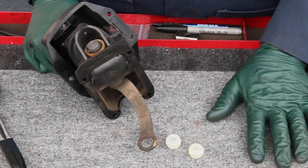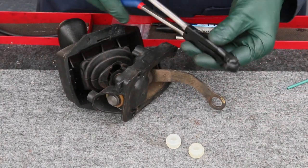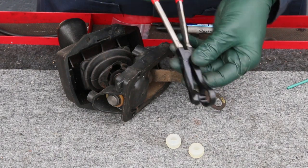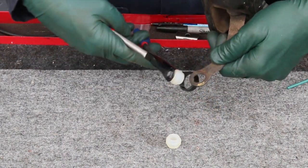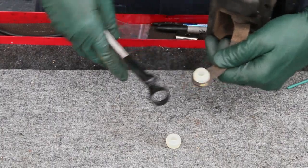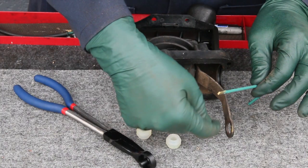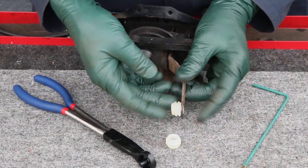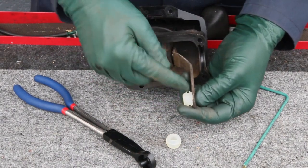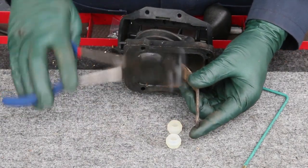These are a very inexpensive part but they're not very easy to put in, and I've done a number of videos about this. This is a special tool we now make in our shop which will allow you to get into the car and press the bushing in — it just snaps right in. This tool also helps you get the little safety clip off the rod, which can be as much frustration as getting the bushing into the hole. There's no way to push or squeeze them in with a screwdriver, particularly when working under the car — that's where this tool really does the job.